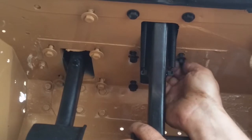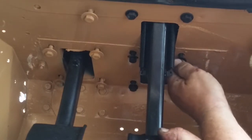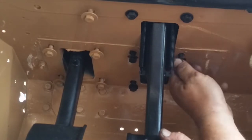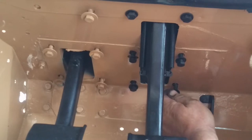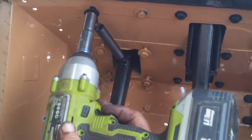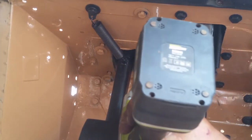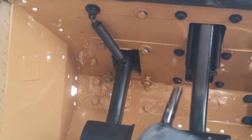I'll put the proper connectors on, rebind the wiring loom in one of those modern wrinkly conduit flexible type plastic products — make it all look nice, fresh and tidy. The good thing about those is that they have a continuous split all the way down the back, and if you ever need to get in there to check anything you can just pop the cover off and inspect the wiring all the way along the loom without having to unbind it.